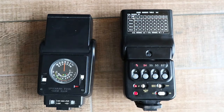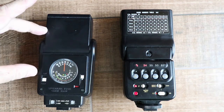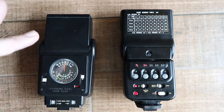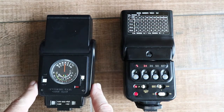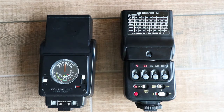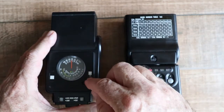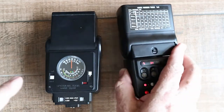There's a pilot light that illuminates when the flash is ready to fire, but unlike the 199A there's no confirmation light — because with TTL metering the feedback comes through the camera, so you check the viewfinder for blinking lights. With the 199A you had to manually dial in the ISO and work out the shooting distance to set the aperture using a color-coded switch. With the 300TL neither is necessary: the T90 reads the DX code on the film canister and passes that to the flash, and an IR sensor measures the distance automatically.